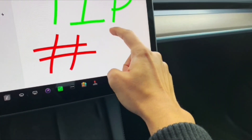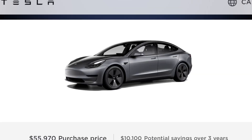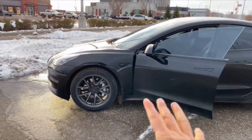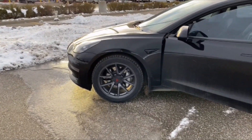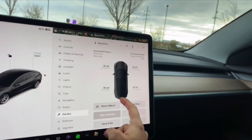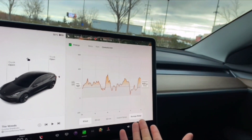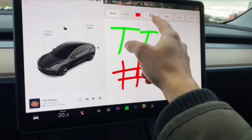Moving on to tip number three: after you've fitted your winter tires, reconsider using the aero wheel cap kit on your Tesla. Beneath those factory aero caps lie some alloy wheels. Tesla offers cap kits for summer, but come winter you'll want those aero caps back in place — they boost aerodynamics and prevent snow from jamming on your wheels, helping extend your range. After refitting the aero covers, head to Service on the dashboard, scroll down and click Wheel and Tire, select the Aero 18-inch V2, and click Update. This ensures your Tesla updates range estimates, tire pressure alerts, and visually matches the aero covers.